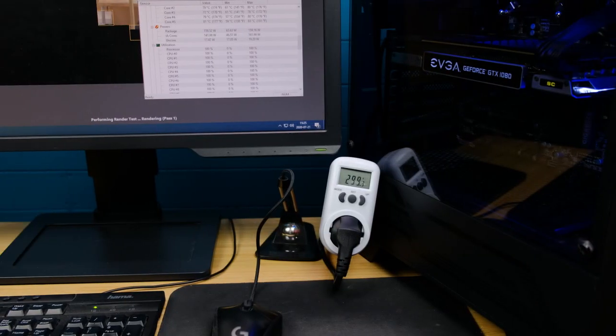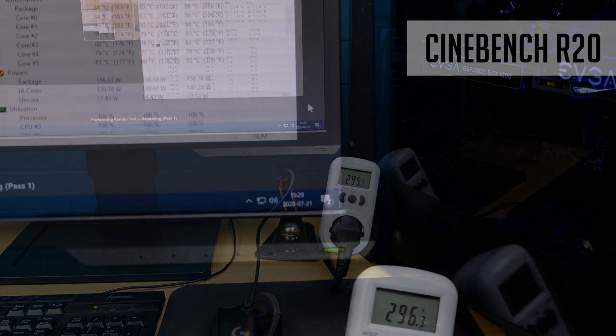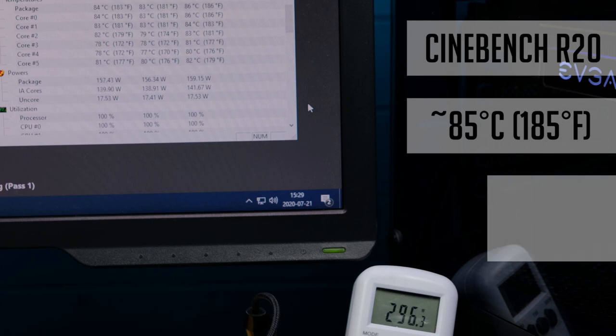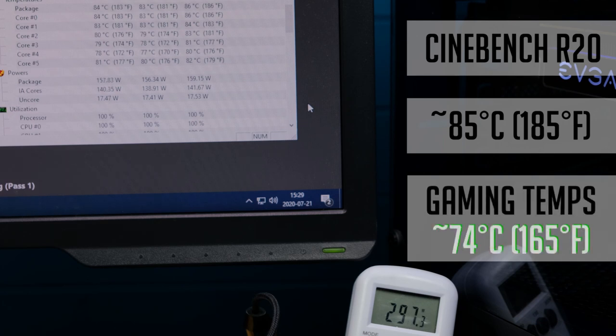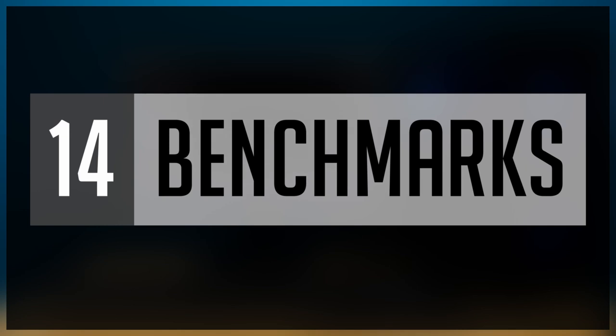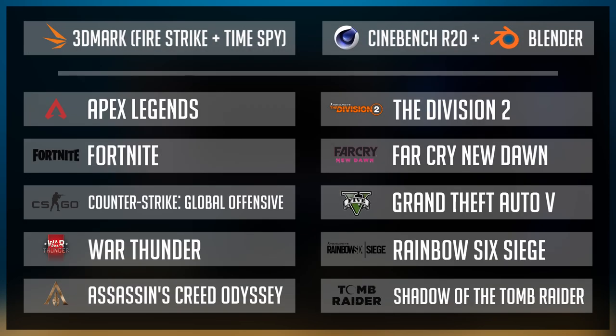But what about that old 120 AIO? Well, it was working with no problems, and during the Cinebench R20 benchmark, temperature was around 85 degrees Celsius. That's actually not bad, bearing in mind that most likely you will not get 100% CPU utilization while gaming. But sure, no CPU overclocking can be done at this point. So let's have a look at benchmarks. First of all, I will run through a few synthetic benchmarks like Cinebench, Blender, and 3DMark, and then we will switch to gaming. In case you're looking for a particular benchmark, you will find all the timestamps in the description below.